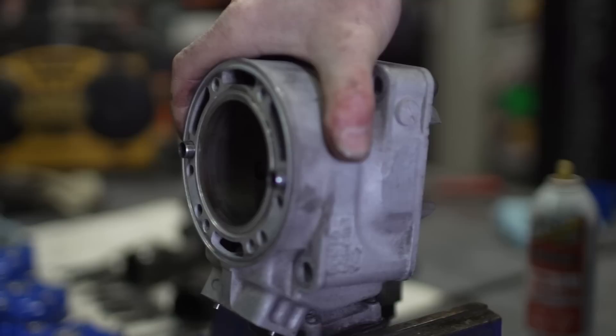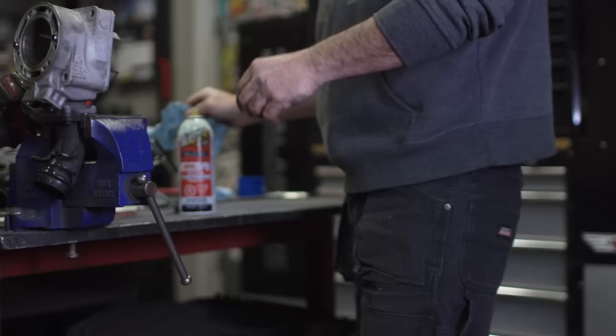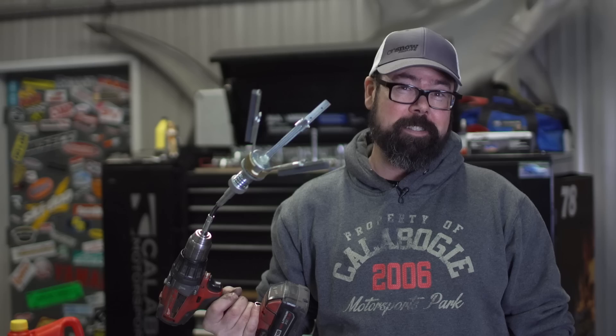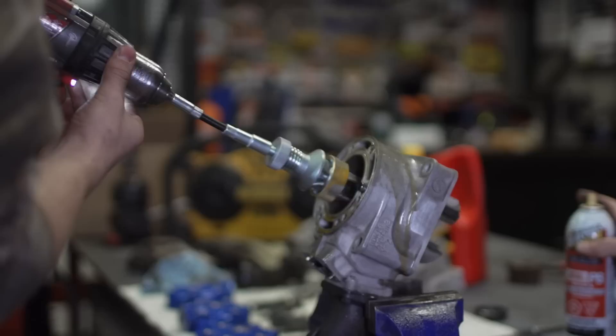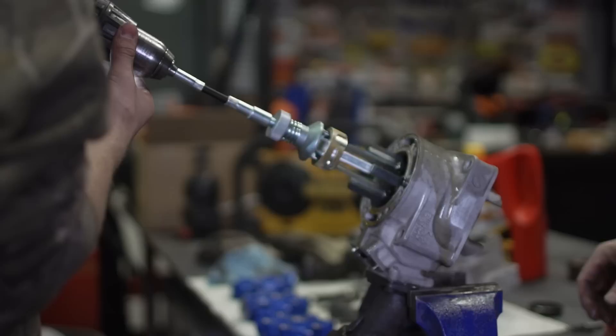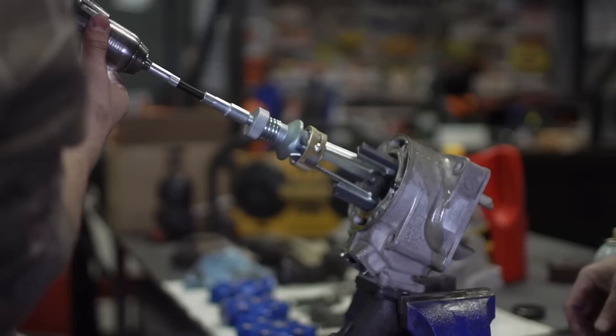Another cost I'm avoiding is rebuilding the cylinders with a new Nicosil coating or buying replacements altogether. Nicosil is the hard coating on the inside wall of the cylinders — it's very thin and super hard for a long wearing surface. The inside of these cylinders don't have any deep scratches, which is good, but they're polished pretty good from the wear. Almost all of the crosshatch pattern is worn off. And because the hatch is worn off, the next thing I'm going to do is super controversial. Online I cannot find the answer as to whether or not you can, can't, or even should hone a Nicosil cylinder — but I'm going to do it anyways. The new rings will most likely glaze and not seat properly if there isn't any hatch left, giving up any gains you might have had by installing the new rings in the first place.